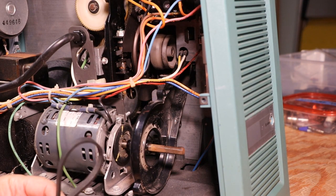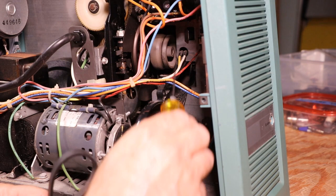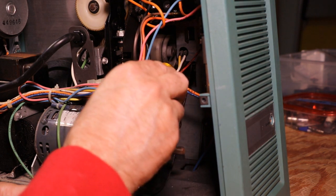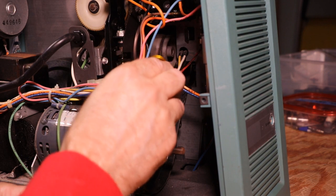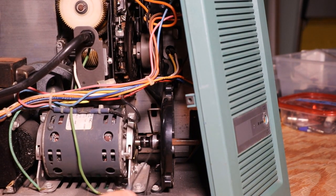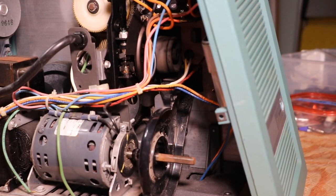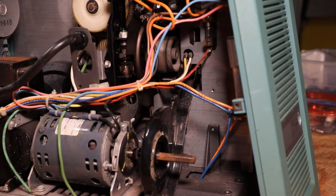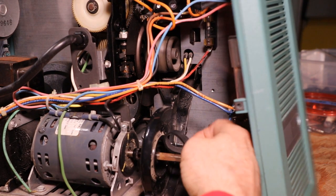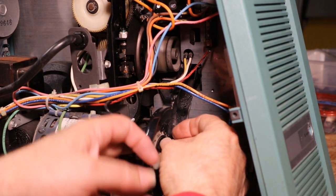It's time to put this belt back on. There's a new belt. I want to show this from a couple of different angles because once my hands are in there you won't be able to see much. This is the upper pulley — the belt will go in this gap to get to the back side and there's not much room in there. It'll wrap around that top pulley, and on the bottom it's going to go around this motor pulley. So let me try to get started and move this to one side so you might be able to see something. Put it through the back of the fan shroud, same way it came out.